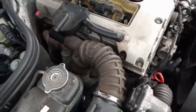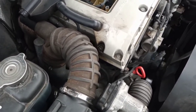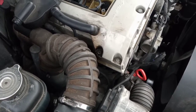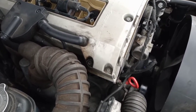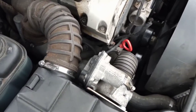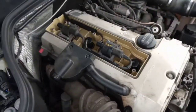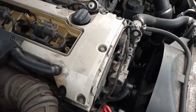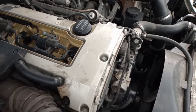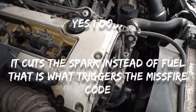Right, so guys, obviously I'm going to explain it in the next part of the video that's coming up, but a few things that I didn't quite explain was why you get multiple cylinder misfire when the MAF sensor's failing. Well, when it's failing, it's not completely stopped working, so it tries to alter the mixture. When it's completely failed, or it just determines that it cannot read the airflow, it will disengage the supercharger and open the bypass valve, as I say in the video. But while it tries to guess, it will cause a multiple cylinder misfire because it is literally guessing the airflow. It's sort of partially reading some, but it's not quite reading it good enough to get the mix right, and the computer just, I don't know what happens exactly, but yeah, it doesn't like it.